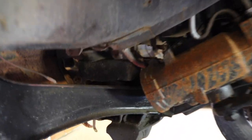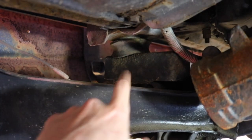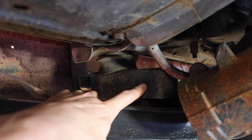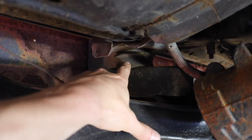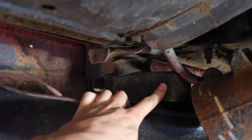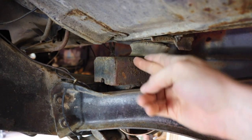The reason why the front is going to be so difficult is this is a 70s front clip on an 80s frame. The body mounts were offset — we used tubing and then the body mount here to offset it forward so it would land correctly, because the body mount normally would have been further back. Here's a better shot of it.